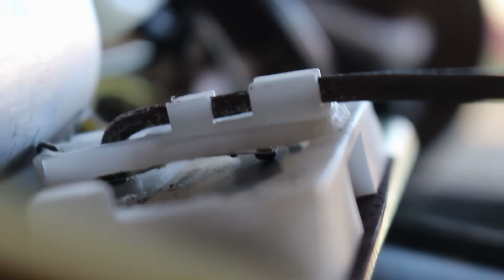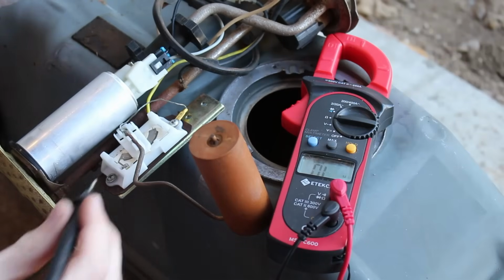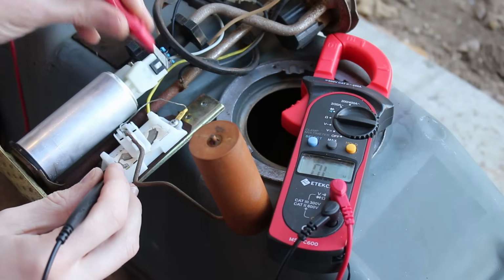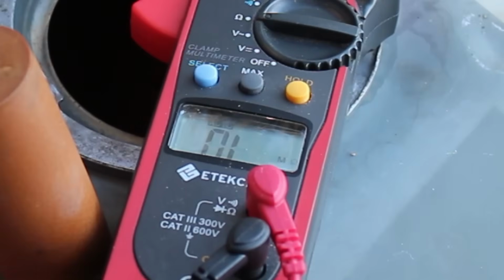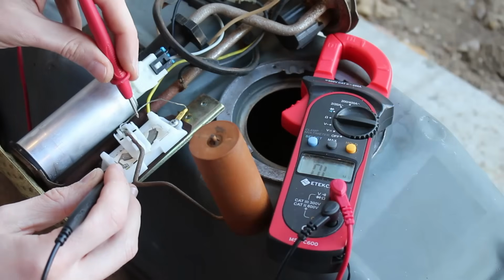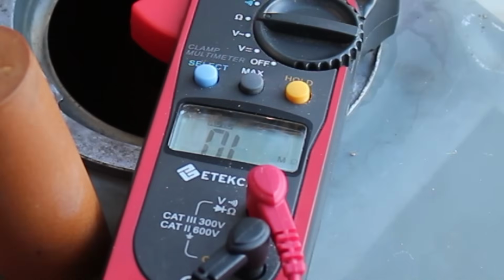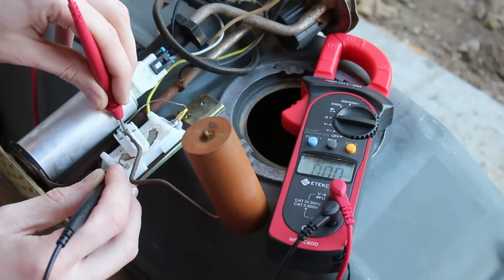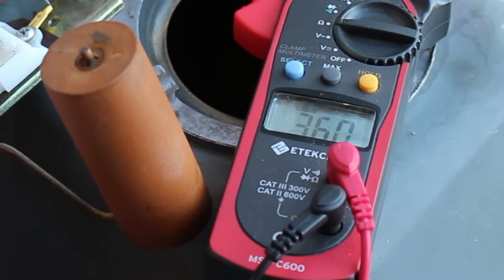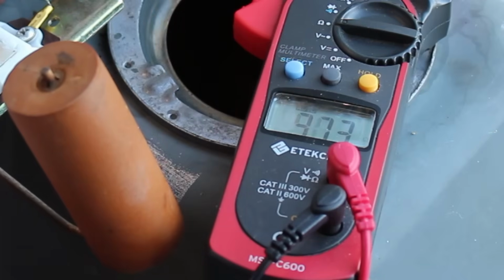I did a lot of prodding and probing with the multimeter until I finally figured out what the problem is. When probing the start of the potentiometer and ground, we should see a resistance value anywhere between 0 and 90 ohms, but it's showing an incomplete circuit. I moved from the ground bolts to the actual solder joint at the start of the ground wire, but still nothing. Only when I touch the actual metal of the pivot arm do I see an actual value, and one that's reading exactly as it should. It looks like we got ourselves a cold solder joint, boys.